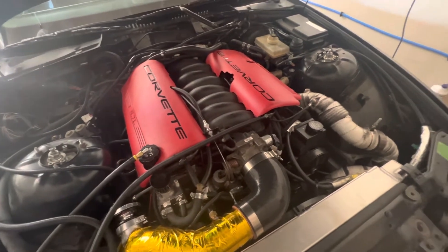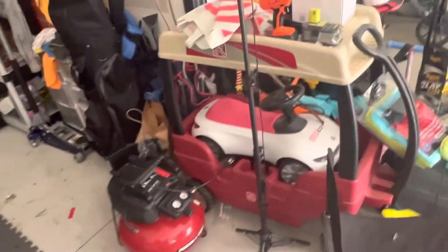I've fixed most of the boost leaks in this car. No matter what car you have, making something like this — which is really cheap and you can get most of the stuff at Home Depot — is definitely going to work if you have a little small air compressor. I used a pancake air compressor; it probably would have been a little easier with a bigger one so it wouldn't have to run all the time. Let me know if you guys have any questions. I'll put links to some of this stuff in the description below. This will work testing any boost system you have — just make sure you have the right inlet coupling and double check the size of your turbo first. Thank you guys very much for watching, and I'll catch you in the next one.